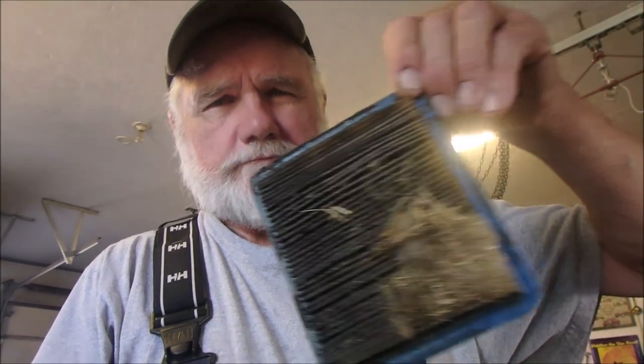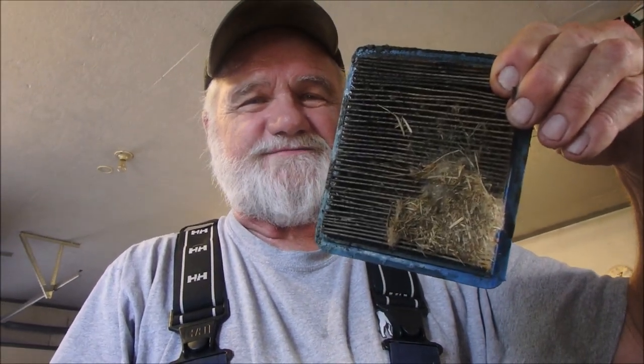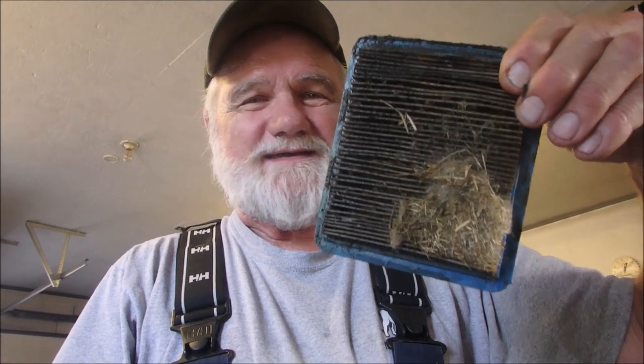So this is quite common midsummer. This is the kind of stuff that you find. So that's a relief. The gentleman that owns this is a really nice guy, but I don't think he's mechanical. So now, I guess, we just have a tune-up. But I'd love to see that plug, eh? It's probably been pulling oil out of the crankcase through the vent tube, the PCV tube, into the filter, eh? So that's really interesting. So I'll just take a break here and we'll come back.